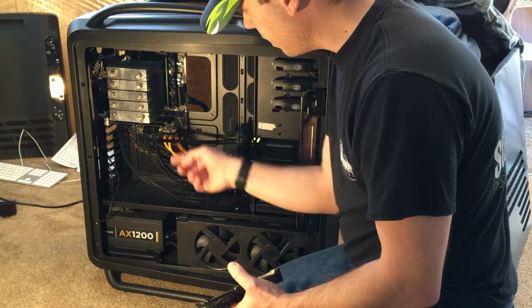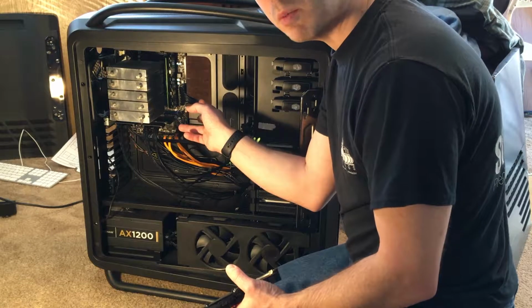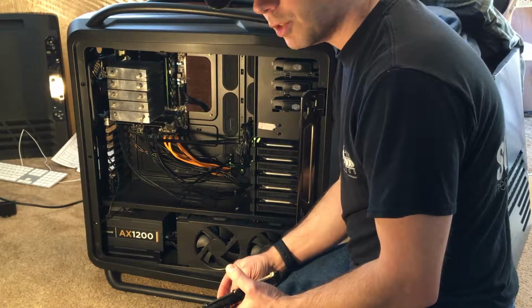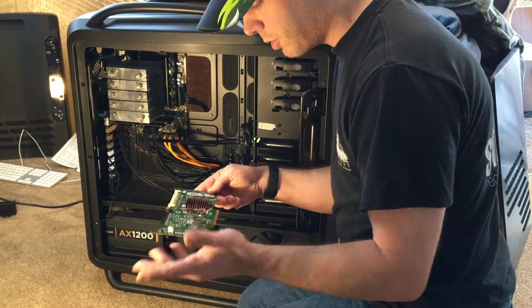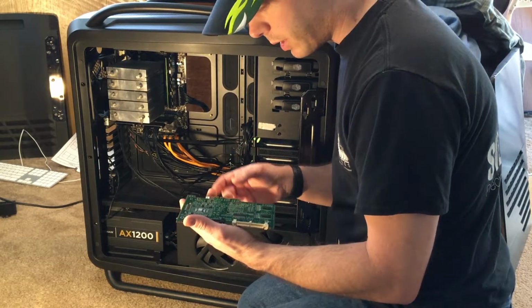Some people say put some electrical tape over those pins, but I don't want electrical tape coming off and getting stuck in my socket. If you don't tape over those 2 pins or otherwise disable them, the motherboard won't post, at least on Intel chipset boards, and there doesn't seem to be any generation limits. The reason is that's some SM bus communications protocol intended for server motherboards, and when it's not a server motherboard, it just keeps it from posting.